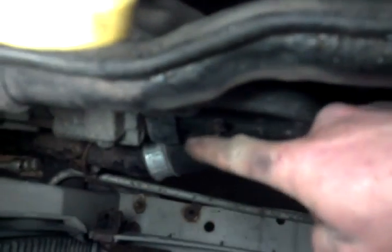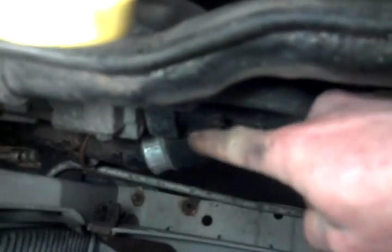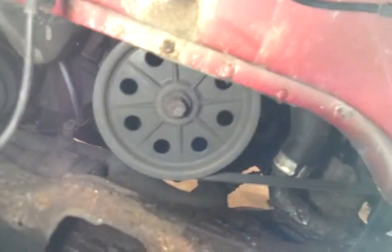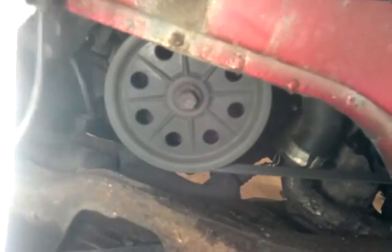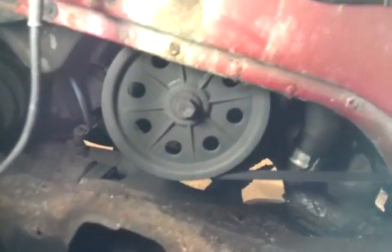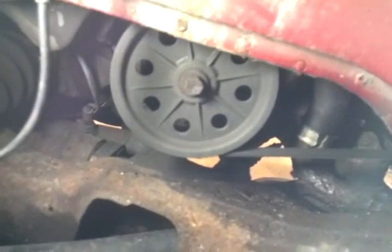because that's the other end of that tube right there. I already slid the spring clamp off, getting ready to rip that out of there, but I got to pull that serpentine belt off first to gain some access. And I got to change that pulley anyways, which is reverse thread to get it off. There's arrows on it, and I think that was a 5/8 or something fits that from the other ones that I've changed.